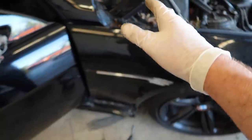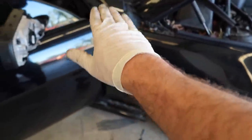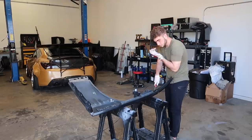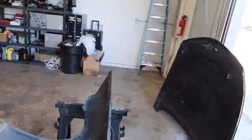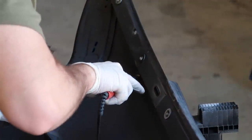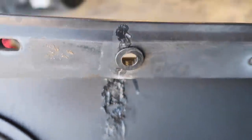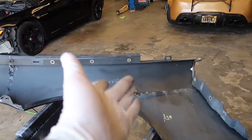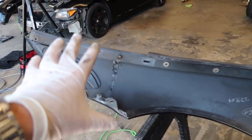This one I'm able to bolt down without the crack showing too much, but since this one has a gap you guys can clearly see the crack is exposed way too much on this fender. I'm gonna take off this fender and just start partially repairing it from the back, and when we actually start wrapping I'll put a little bit of bondo in the front and then wrap over it. Plastic weld actually works — check that out, that's actually kind of crazy. That one's in pretty good now, and this whole crack used to just separate on its own — there's nothing separating it right now. So I'm going to throw on the fender, and any other touch-ups we need to do we can do on the outside. It is ready to get thrown on the car.